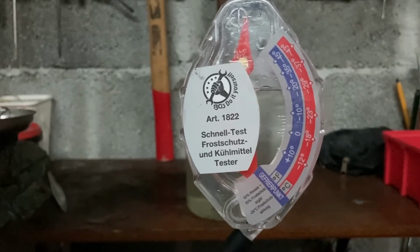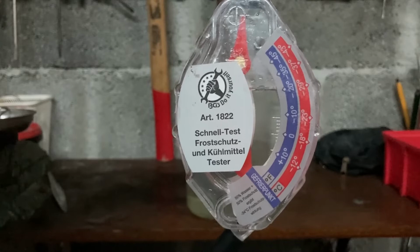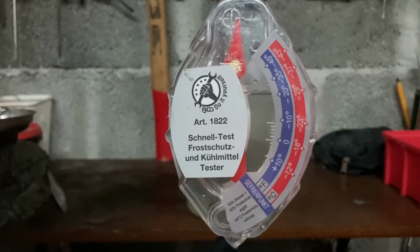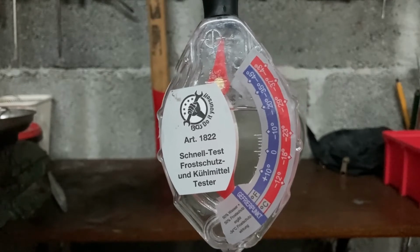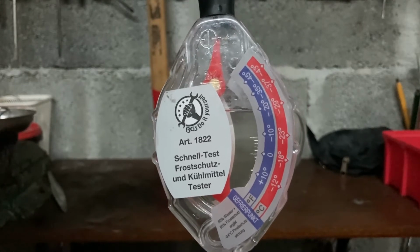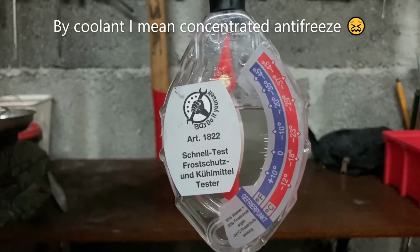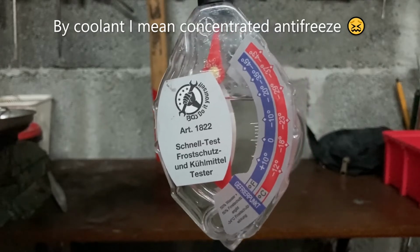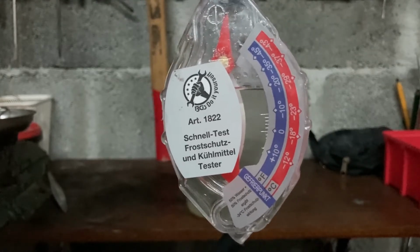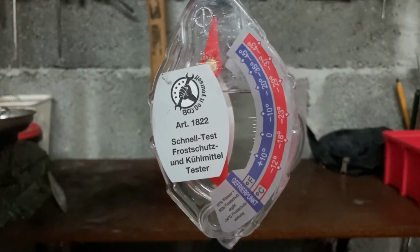And do note that on average we have removed about 3.3 to 3.4 liters of coolant with each individual drain. This means that we will not be able to reach a 50-50 mix of coolant and water with only one fill of coolant, because we'll only be able to add about 3.3 to 3.4 liters of coolant, but we will also need, obviously, one more drain and fill.